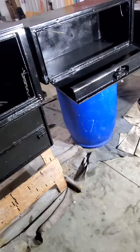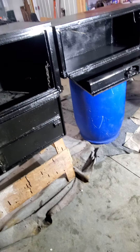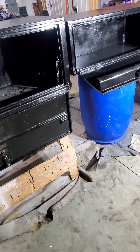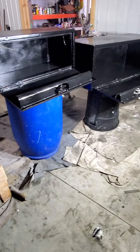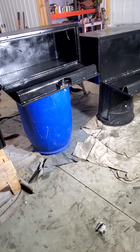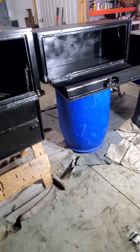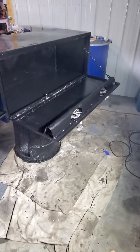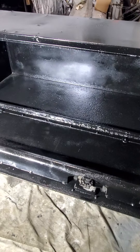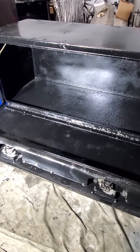I even did the bottoms because I didn't think I was going to have enough — I literally thought that three quarters of the can of rust inhibitor wouldn't be sufficient. And if you're going to do this: these boxes were super bad before we had them sandblasted. Don't try to just take sandpaper to a super rusty box that's way far gone. You're going to end up spinning your wheels on it. So do the right thing and have them sandblasted.